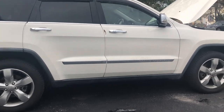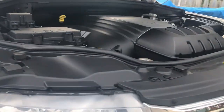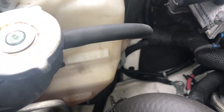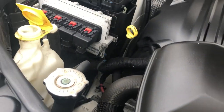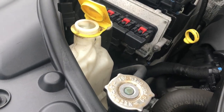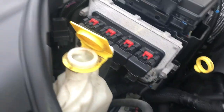So, just a recap, it's the next day, and it was hard for you guys to see in the video yesterday. If you can see now, the level is now down from when we added. So, should have gotten all the air out of the system then. We're gonna just top it off, get it up to the rest of that fill line there. And she should be reading nice good temps around 180, 190.